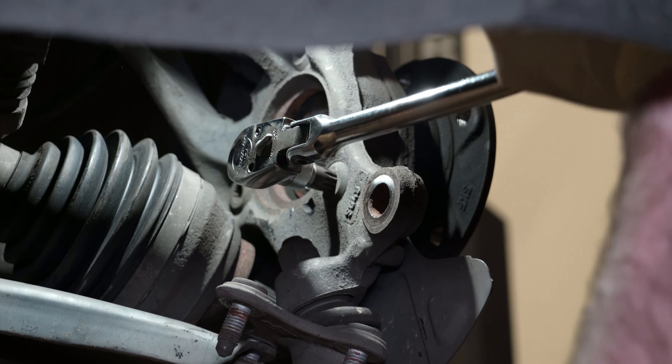The new bearing comes with bolts and the axle bolt — you should replace them. There are other one-time-use bolts involved with this, but as mentioned, you're not going to replace those. We're going to get her bolted down and torqued down. The axle has to go back into our wheel bearing — make sure your splines are clean. Stick it in, get her splined up and lined up.